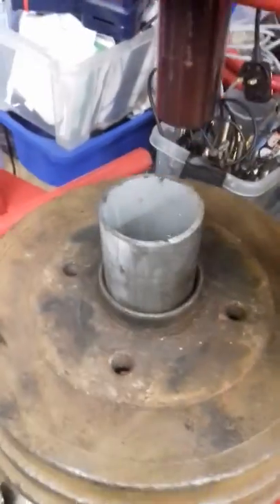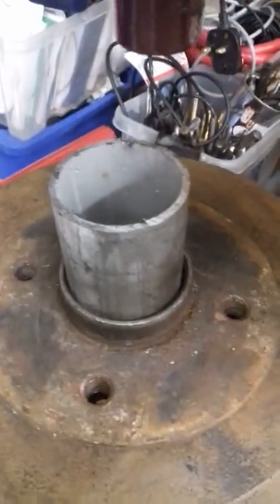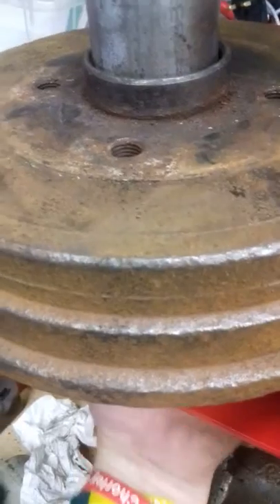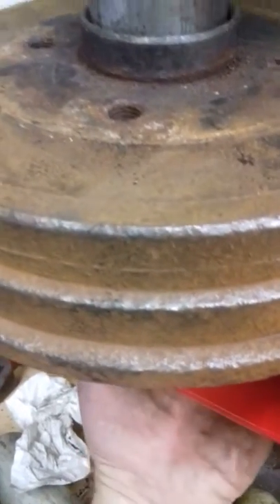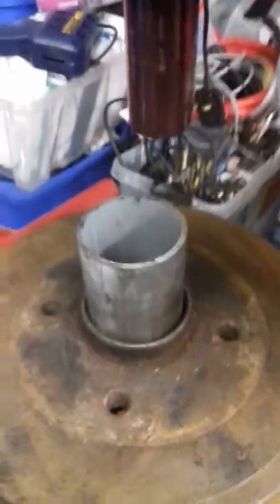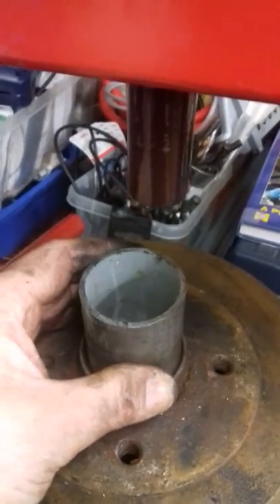When you press, luckily enough you can feel up the back of the drum — you can see my hand there. Feel inside and you'll be able to feel the bearing as it's coming down, and you'll be able to feel that the notch has been filled. Also, as you're jacking it down, the movement will stop and the jack will probably get quite noisy as it's bottomed out.